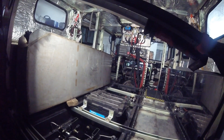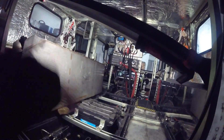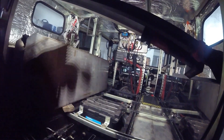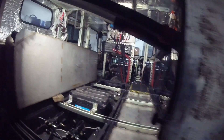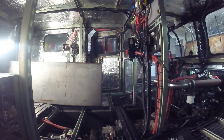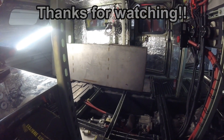I totally finished it off by putting it in a snowcat — it probably had low pressure issues and all kinds of stuff. So I'm glad I went through the transmission that Nick gave me, put brand new parts in it, and put it together. Fingers crossed everything works as it should. I've shifted it through the gears and turned it by hand, and everything seems smooth — the parking pawl works. But as far as today goes, I think that's going to be it, guys. If you liked this episode, give me a thumbs up. If you're not subscribed yet, I'd love to have you as a subscriber. Hope you're staying safe, taking care of each other, and I'll catch you next time. Bye-bye.